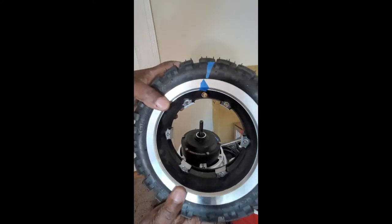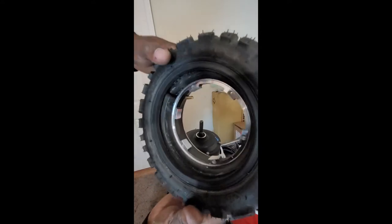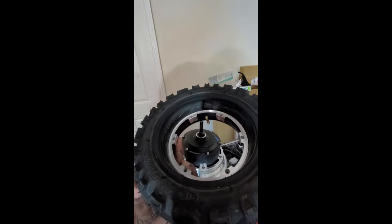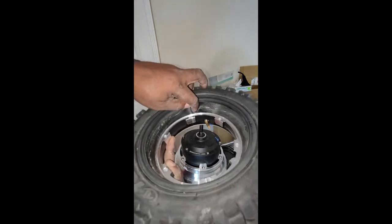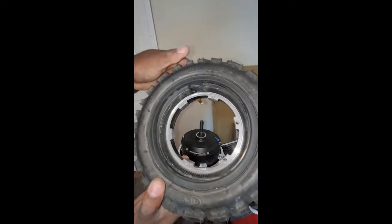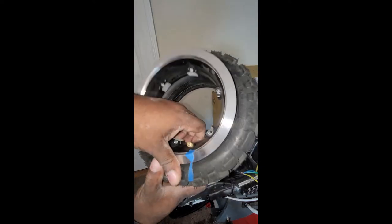As I look at this tire and rotate it towards the back, the first thing I notice is the inner tube is kind of cocked right here — a little bit bent, folded in there right where the nipple is. The nipple goes in here and it's a little bit folded over. I'm going to rotate the tire and pull this right off.